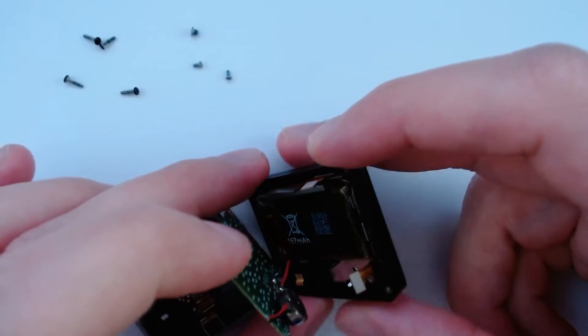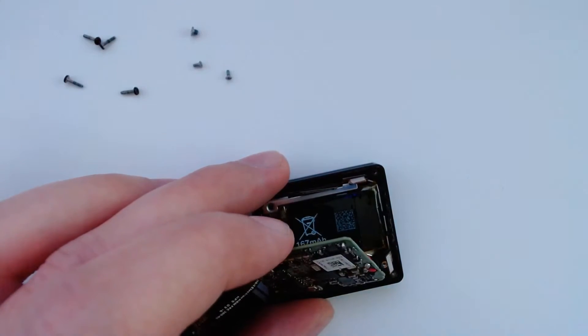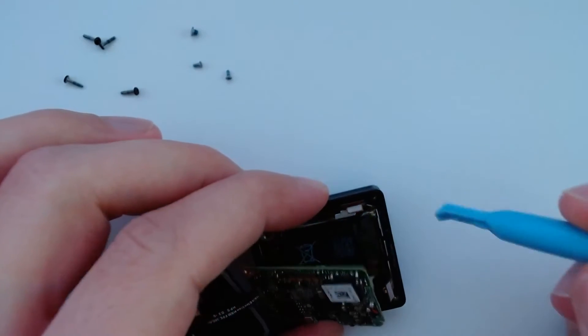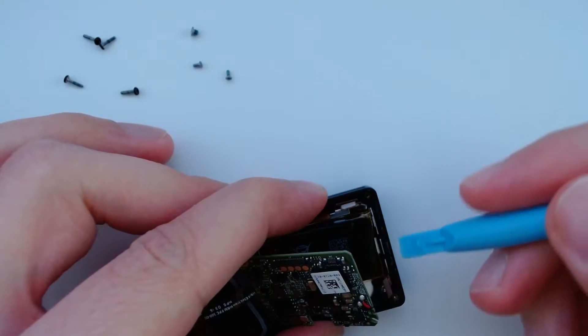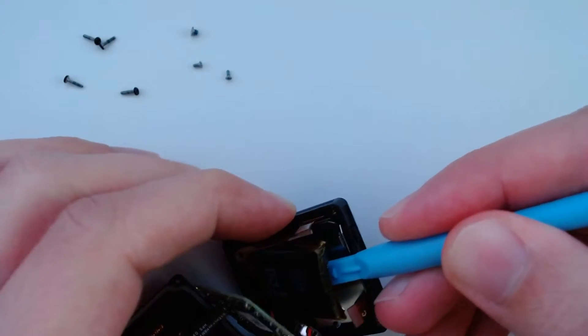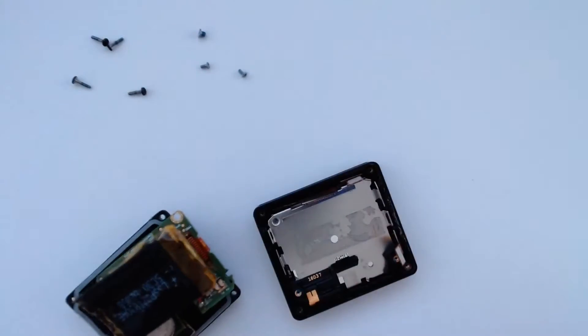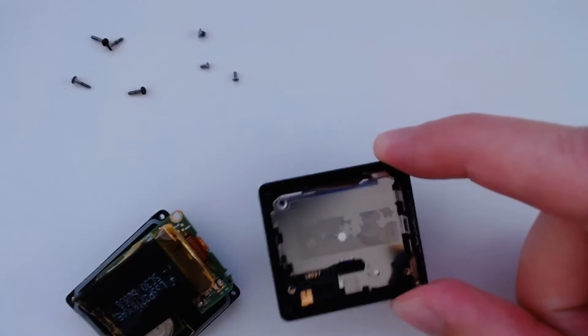Those wires are connected to the battery, so they'll need to be desoldered and then we need to solder on the wires for the new battery. But first let's remove the battery — there's some double-sided tape on the underside. You'll need some sort of prying tool to remove it; you can use a screwdriver or a plastic prying tool like the one that came with my kit. Just stick it in there and start pulling up a little bit — don't be too aggressive so you don't start bending the Fitbit or damaging the screen. Go underneath and push up until you can unstick it from the housing.